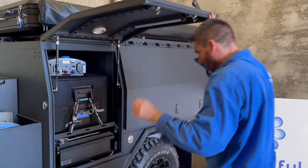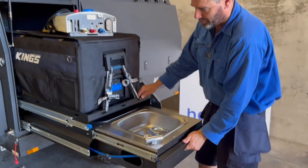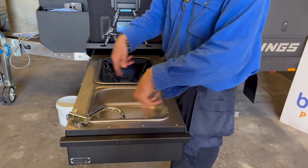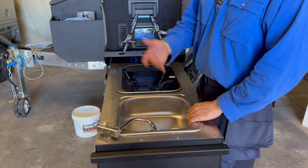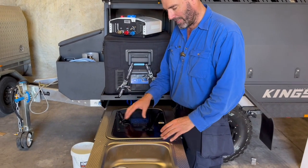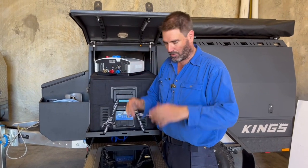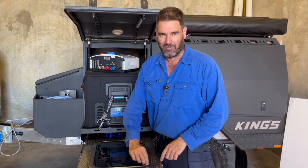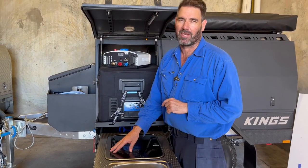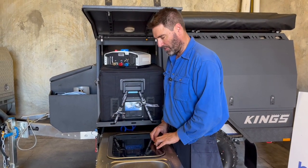Let's just open her up here and pull the fridge slide out. So there's already a hole here for the Dometic sink — we just had to cut it a bit bigger. It's stainless steel so it's difficult to cut; you've got to make sure your holes are right. Same with the Dometic hot plate — the template they give you on a bit of paper isn't a nice one to draw on; you have to work it out yourself. They don't leave you much room — it's only 5mm of meat — but you can leave a lot more on the edges. We've done lots of these so we leave a lot more meat, especially on the corners, for it to sit on.